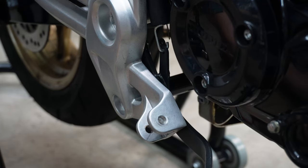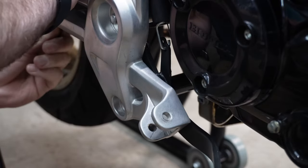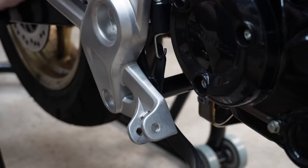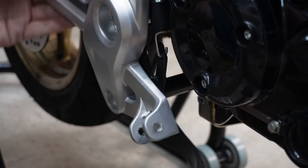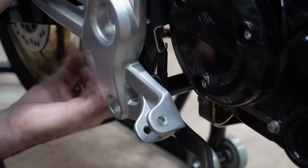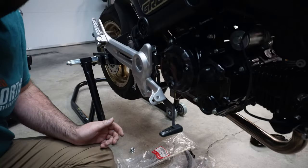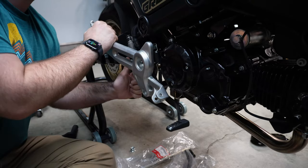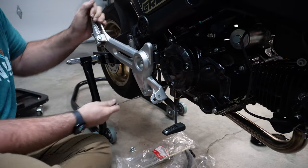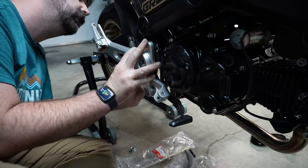Okay, they're good there. And then, like I said, there's a couple 8mm bolts on this master cylinder that we can take off. I probably should have done this before I undid the side plate itself. That's all right, man. That one started. Whoa. Note to future self, maybe skip me struggling with this. Yeah, definitely keep your side plate mounted while you loosen these at least. There we go. God. Honda. I have to assume those were Loctite or something, because that was not normal torque specs.